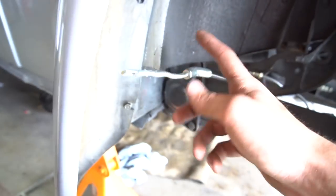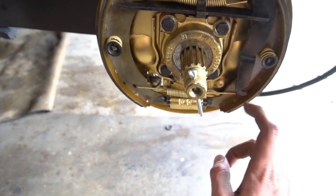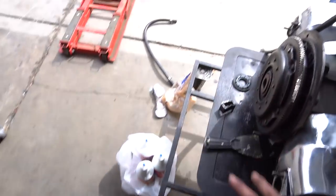I'm going through and tightening all the suspension bolts. After that I need to hook on the e-brake — I have to fix it from inside at the handle because it broke a while ago — then hook on the e-brake cables, tighten the boots, put gear oil in, do my brakes, and change the pressure plate spacer. That's all I can do today.